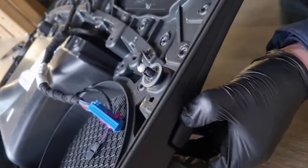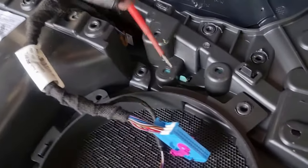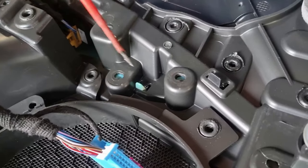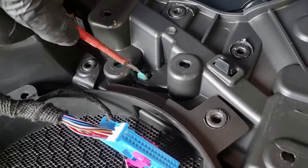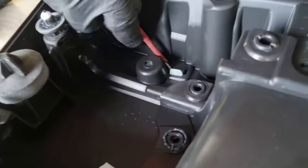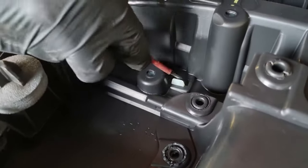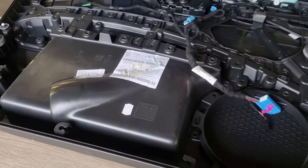Once the handle section end feels a bit loose, put your hand in there and apply a little pressure. Come to the small white clips on the back — you don't need to touch the bigger ones. Using a small screwdriver, bend the plastic out of the way and push the tab through. There's another one at the back of the door — same again, apply pressure from the back, get under the black plastic and push that through on the other side.